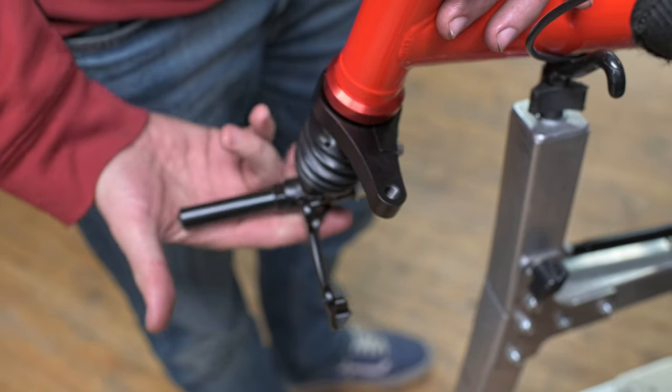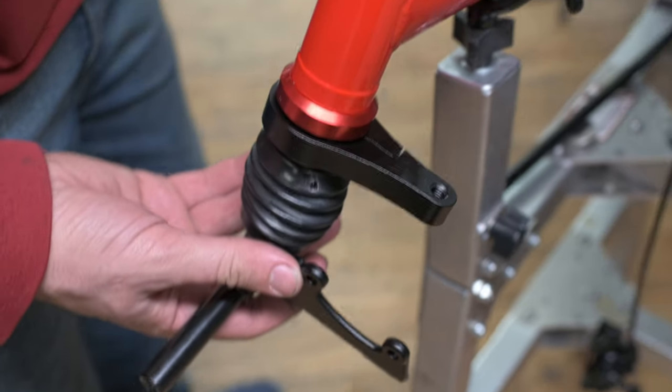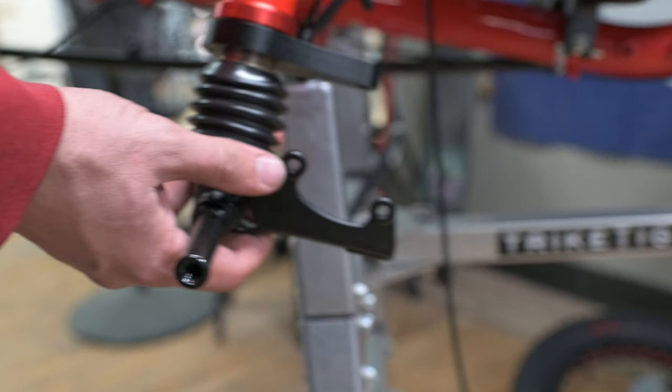However, in the front, we do have an upgrade to improve your steering with our UtCustom Ackerman arms. These arms change the mounting location of the tie rod on the spindle to above the suspension, giving a much more consistent steering feel and reducing uneven tire wear while turning when the suspension is under load. If you're interested in learning more about that, see our other video which goes over this specific upgrade.